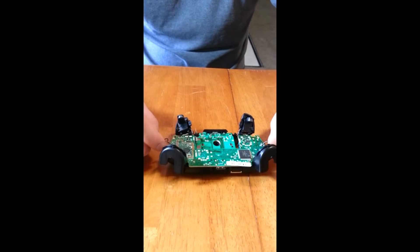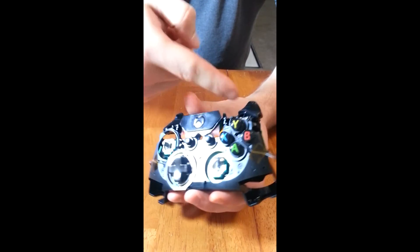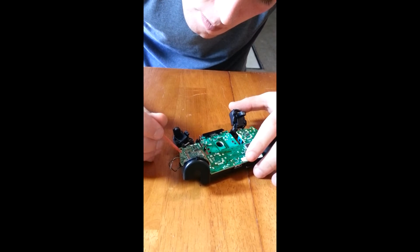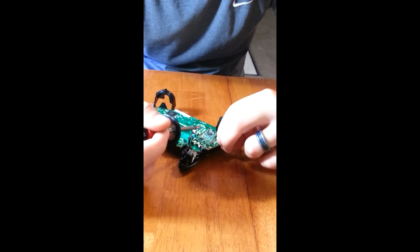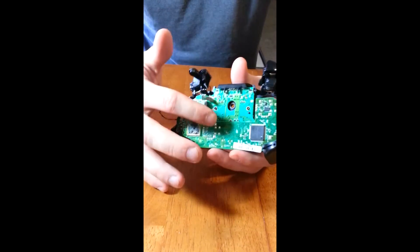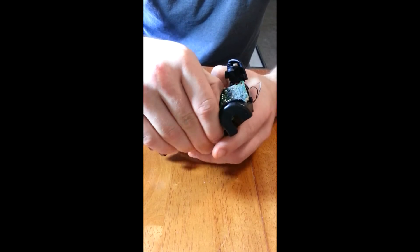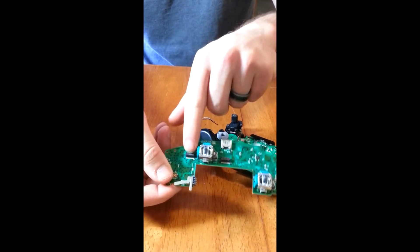You see these other two wires — these ones are not vital to remove, but I'm going to because I don't want to have to take off this tape and unwind it since I like how nicely wrapped it is right now. We're going to go ahead and take those off as well. Use a little bit more flux. Gray's on the inside, black's on the outside, and that's the case for both of them. The next part is actually taking the circuit board off. Right here underneath my finger there's a clip into the board, as well as one over here on this side — pops right off. We're going to go ahead and set this aside.